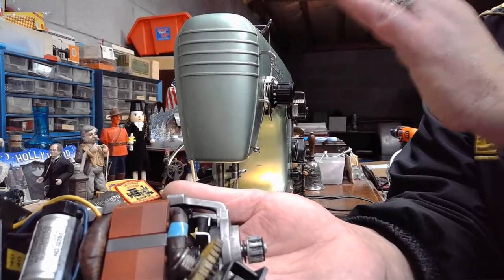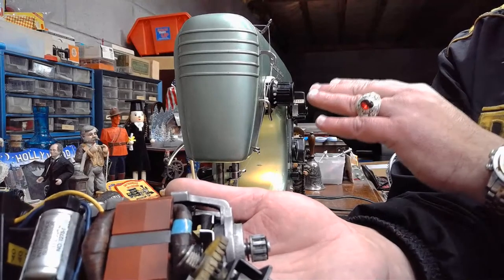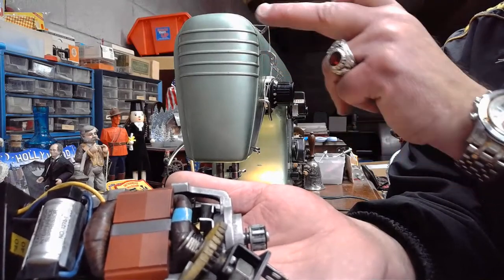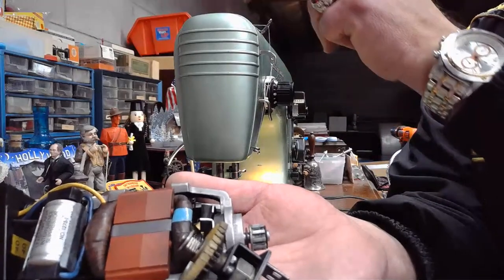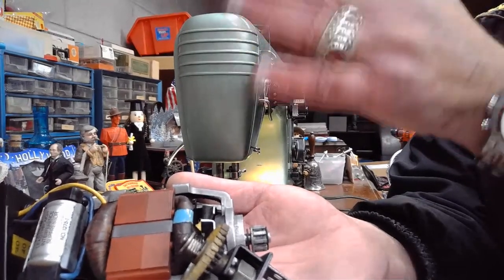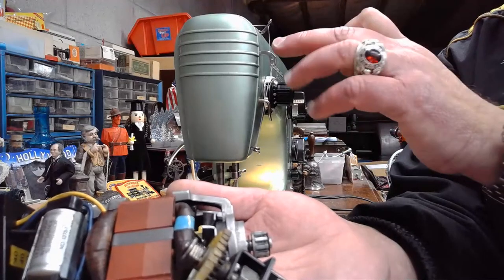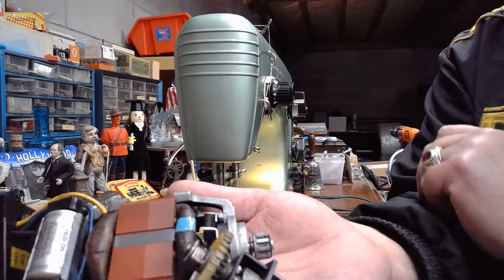And that not only saves you a lot of frustration with, why is this thing making that humming sound that Scott demonstrated, but it won't go? It's because that take-up arm is creating binding because it's in a lower position instead of being at the pinnacle, ready to sweep down in that downstroke. Hopefully that makes sense, and you can avoid a lot of frustration. Plus, you can avoid the bird nesting that a lot of people experience when they try to launch at that lower take-up arm position. Okay?